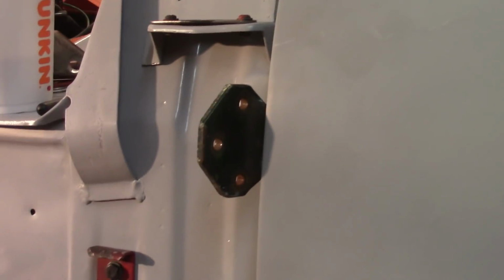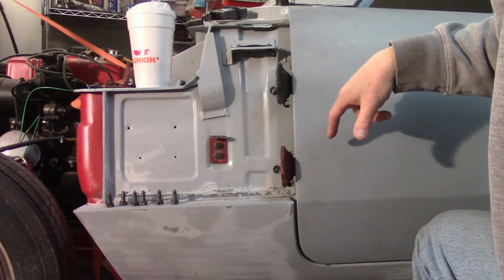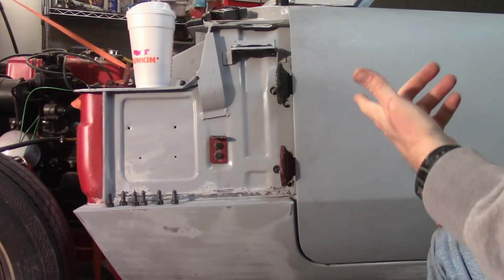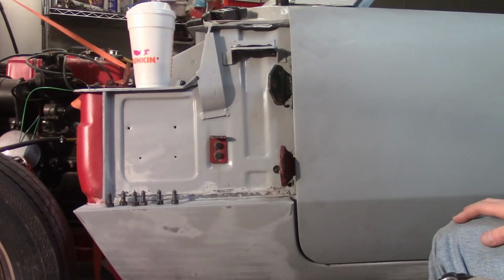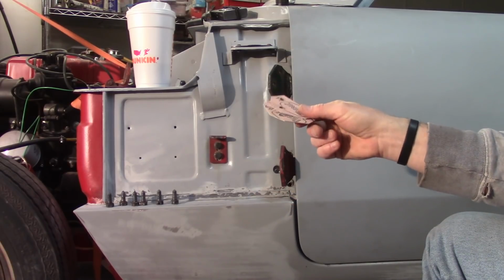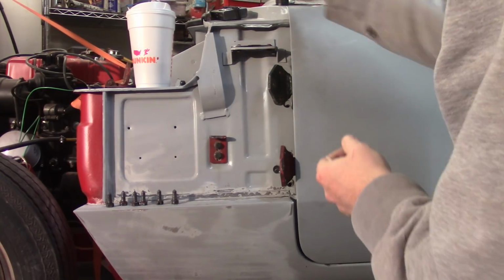But I want to get some hinges in and see if I can't get those things set up to at least try to get the door semi-attached. All right, so again, the hinges need to obviously go on the door, and the hinges are free floating in the door right now. So everything is loose, and obviously the door is not attached. There's not really anything else I can do to get the door kind of in there for me. It's already attached on the back latch, so I'm just going to go ahead and bend these hinges in and see if I can get any screws started. And I want to use my shims here, and if the shims end up being too thick, then I'm okay with that. I either won't use them, at least for now, or I'll look at using something else. Just as a point of reference, shims are about 1.2 millimeters or so, so not that thick, but who knows.